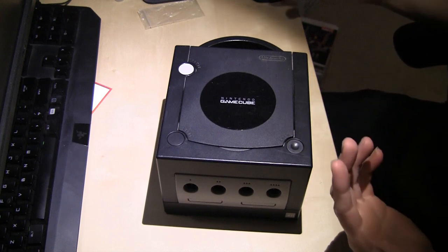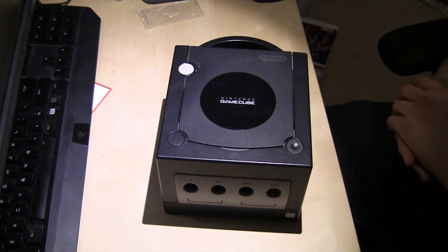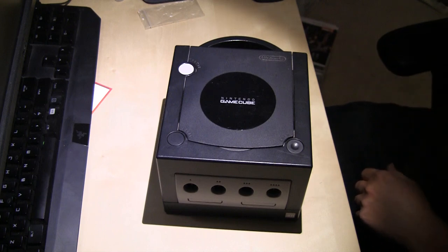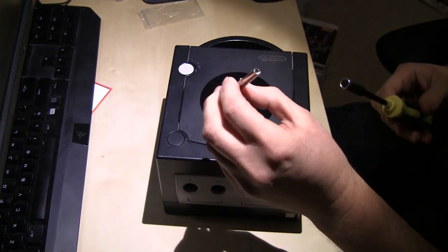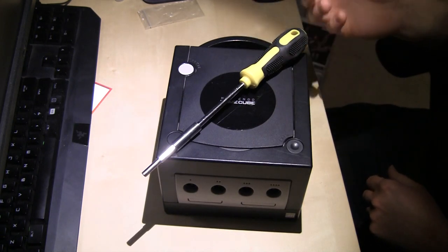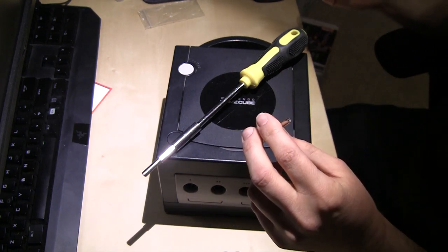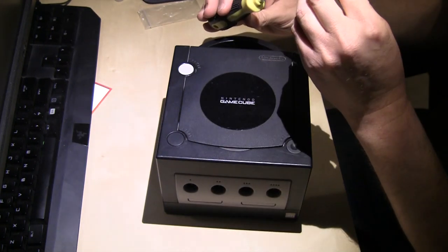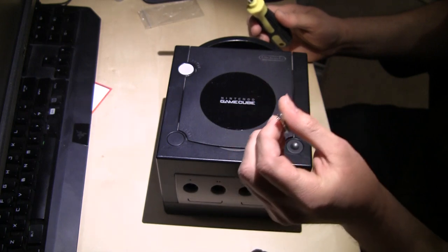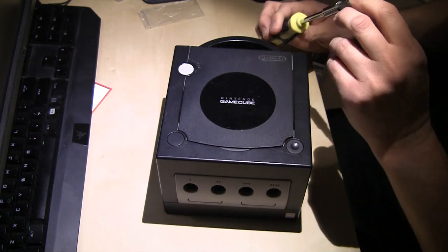I've seen that maybe the lens needs to be cleaned off, so I figured let me just open this whole thing up and clean it out. To do so you will need one of these star screwdrivers. You can get them off Amazon or eBay — I think this one costs five bucks. It comes with two bits, both the star bits that Nintendo uses. The smaller one is used on Super Nintendo and Nintendo 64 games, and the bigger one seems to be for the consoles.